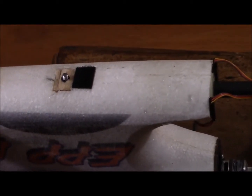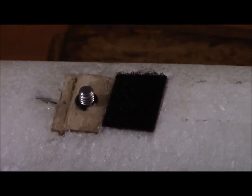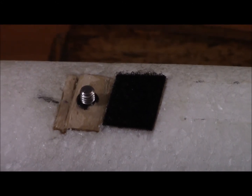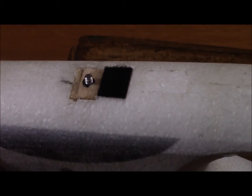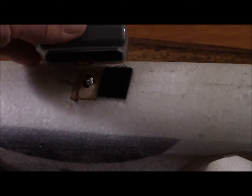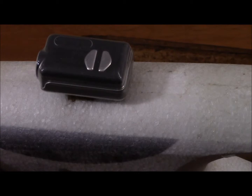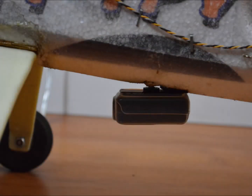The next modification I wanted to make was a camera mount. I recently picked up a Mobius camera. What I've done here is added a bolt from an old camera shoe to a piece of balsa wood, then attached that to the bottom of the plane. The velcro behind that helps to support and prevent the camera from either vibrating off or being blown off by the wind. There's a little bit of velcro at the back of the Mobius camera and it just mounts on. As it turns, the velcro slightly catches as the camera is on a bit of an angle, and it's quite tightly mounted. I don't have to worry about it coming off with vibration. Here we can see it underneath the plane from another view.